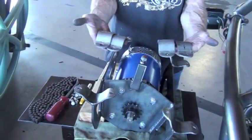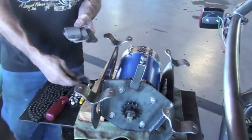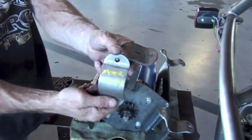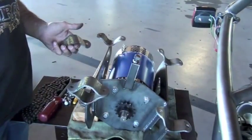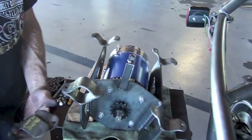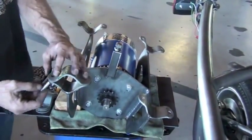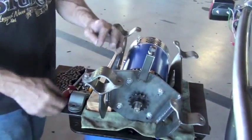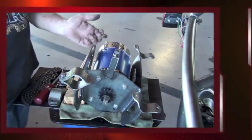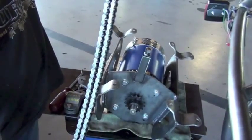When we put the sub-assembly onto the vehicle, it will mount to the swing arm with these brackets at the four points discussed earlier. These just bolt around the swing arm and connect the whole sub-assembly to it. The motor will move laterally side to side in order to line up the sprocket on the motor with the drive sprocket on the wheel, and then we'll put the chain on. We'll discuss further adjustments in another video. This completes our build of the motor sub-assembly before it goes into the vehicle.